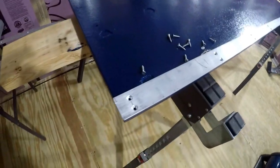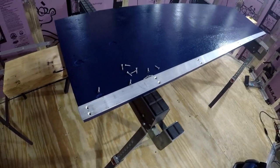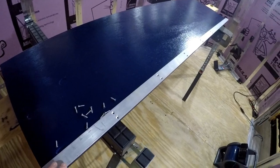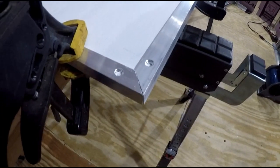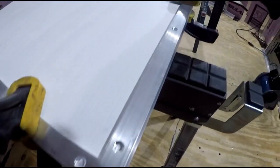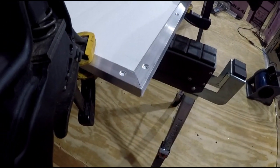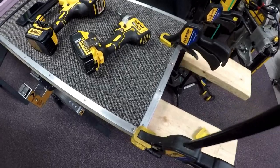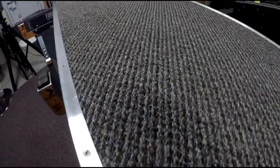Here's the rear flip gate — I painted the inside blue; I've got three or four different blue interior colors. That aluminum strip on the edge is the part that contacts the ground. If you can cut a 45-degree angle pretty decently, it's fairly easy to wrap these boards with aluminum. That's what it looks like before the carpet goes on the flip ramp. I use clamps to crush it tight onto the board, then use an ice pick to line up the pre-existing screw holes — as you tighten it down, everything pulls real tight and the 45s look good.